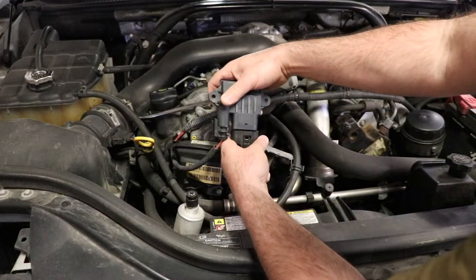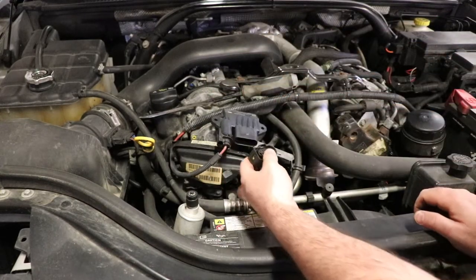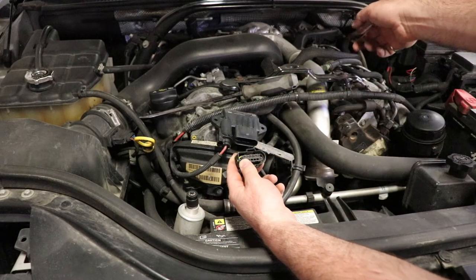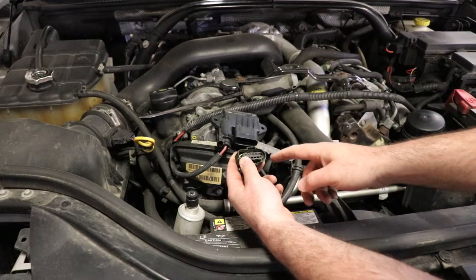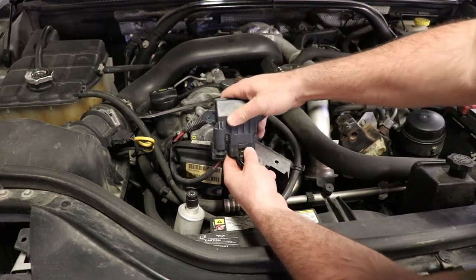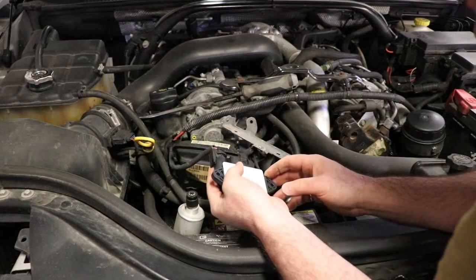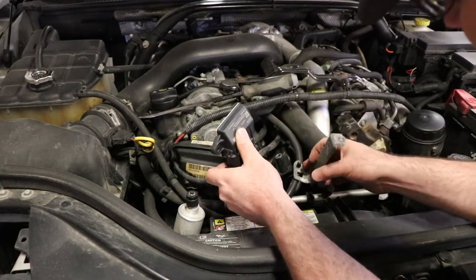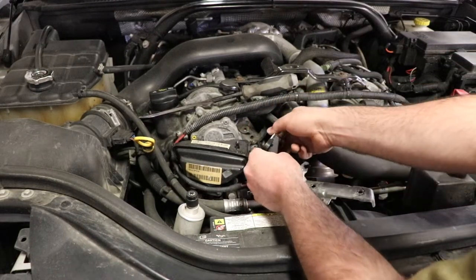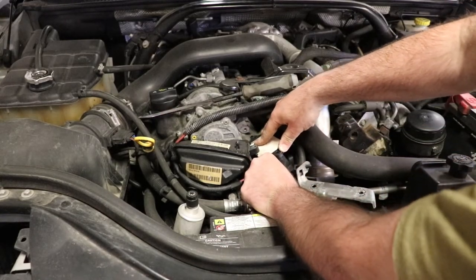Put that on there — it's keyed so you can't get this wrong. Now if you were going to do some diagnostics on here, you could use these pins to reach to the glow plugs and see if the glow plug wire is good, and also check the resistance through the glow plug into the ground. That's in on that side and that side. Put this wire back behind that boss there.